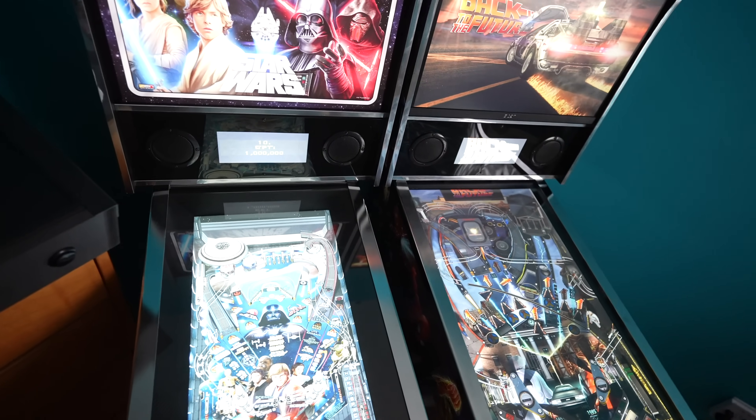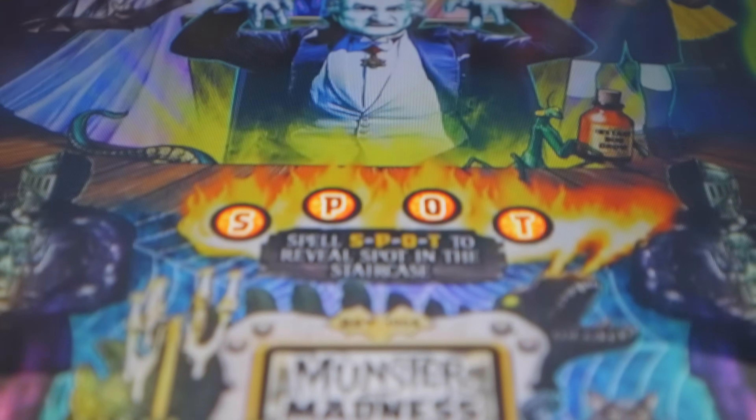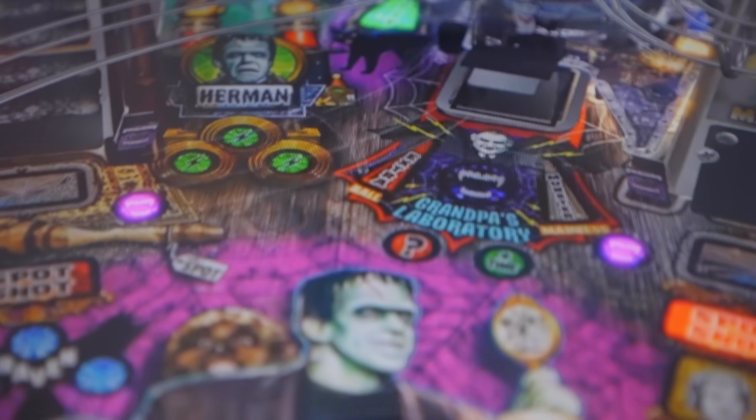My goal was to get the largest playfield monitor possible inside the stock Arcade 1Up body without modifying the body panel, and to make it as simple as possible for anyone who wants to replicate this. You don't have to do 32 inches — you could do a 27-inch monitor, or Dell even makes an obscure 30-inch monitor that's very expensive. Any size works, but keep in mind every monitor manufacturer's sizing is a little different, so you may run into different roadblocks. I'll put the parts and recommended monitor in the description box below.